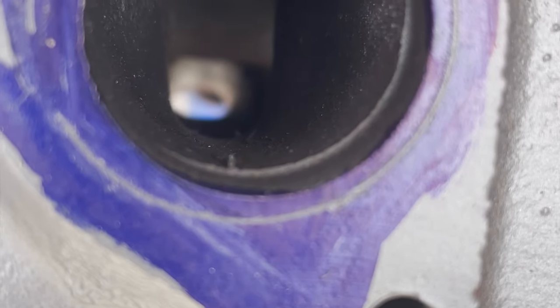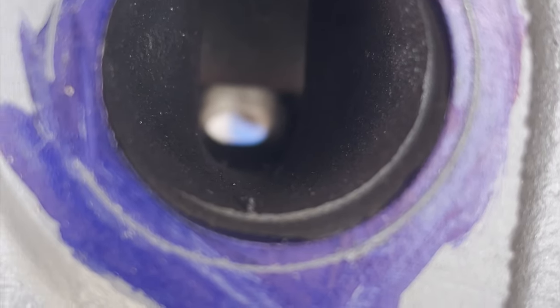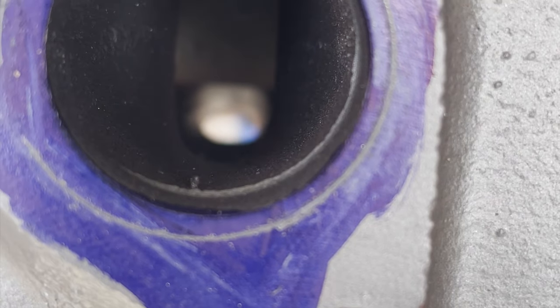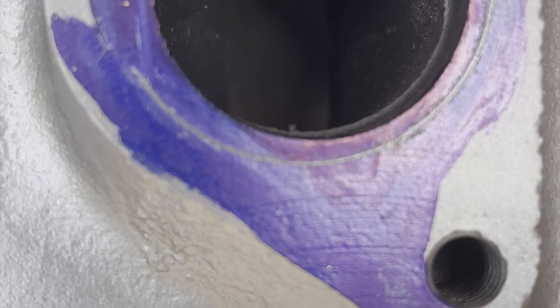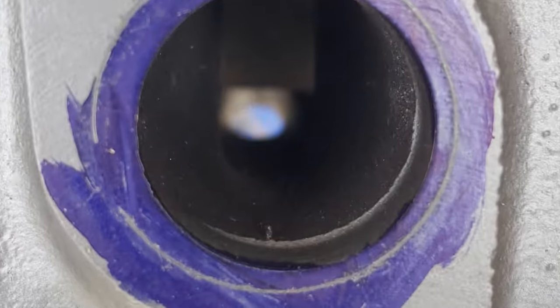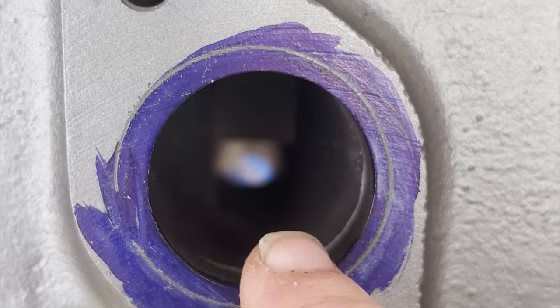And so, that's relatively thin, so we're going to have to blend that in pretty well. I think a 16th of an inch is all you're really supposed to take off once you get past an inch in there. But the top and the bottom, there's a lot of material according to the reference that I saw. So there's a lot of material that we can remove from mostly the bottom. There's plenty in the bottom. This is the top. It's upside down right now. The block is upside down.